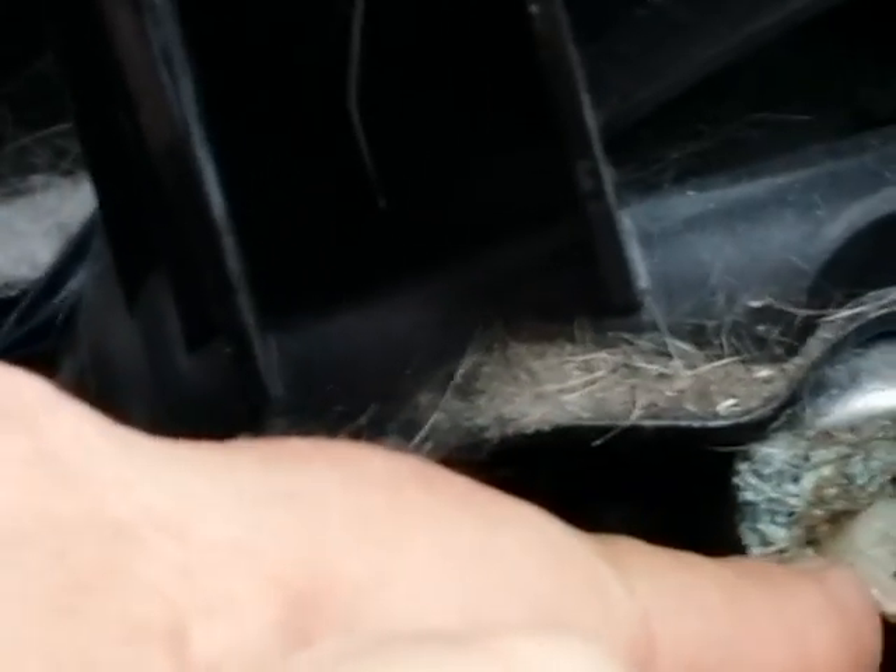What I did is I just isolated that with a zip tie so I could use the car. Now the latest situation: I pulled in, put it in park, turned the key off, and I couldn't turn the key all the way to the off position — it stayed on accessories and the key was stuck in the ignition. Another wire broke. I don't know the function of every wire, but the one with the purple and white stripe is the one that does the key release function.